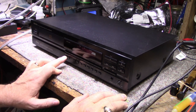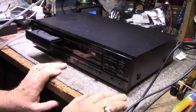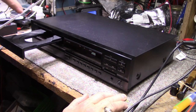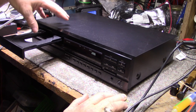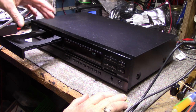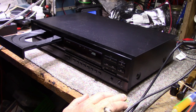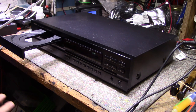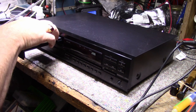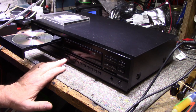So you're probably wondering what will cause that. Well, actually there's a little switch in the CD drive mechanism that tells the microprocessor or microcontroller when the tray is open or closed. And that switch sometimes gets oxidized and dirty and doesn't give the right signal back. So it kind of confuses the microcontroller into thinking that the tray is closed when it's open, or open when it's closed.